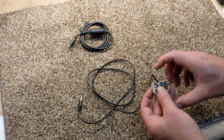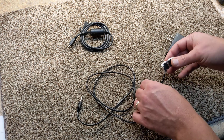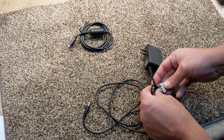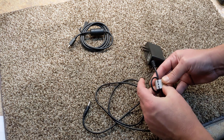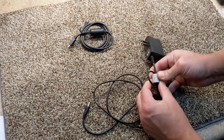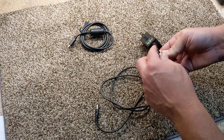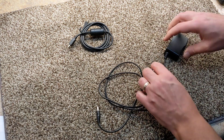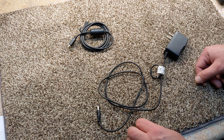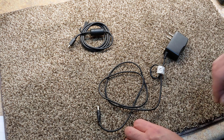A longer one probably would have removed the noise just by clipping it on. The trick now is to go like this and double loop it — basically causing the wire to pass through it twice — then clip it on. The little clip was busted, so a small piece of electrical tape holds it on. As long as it's enclosed like that, it will stop the noise or high frequency from coming through. I did that just a couple of hours ago and it was perfect — I tested it by turning the fridge on and off about 10 to 12 times and not once did it do it.